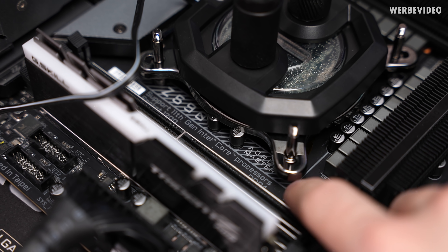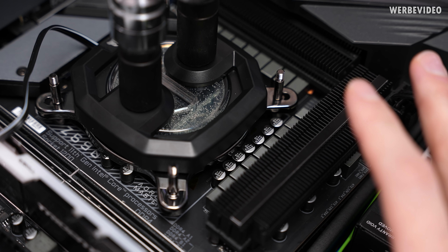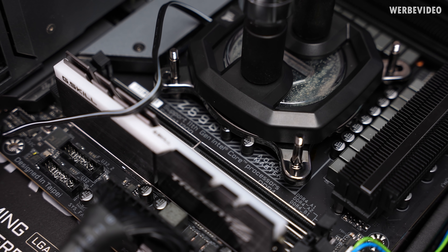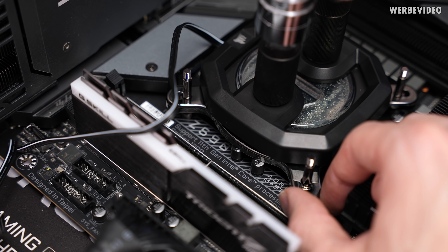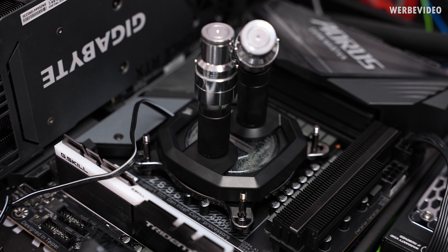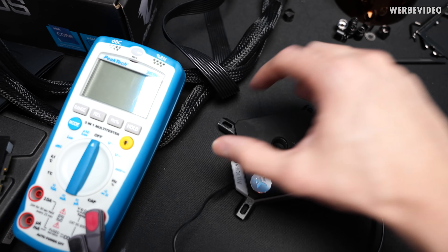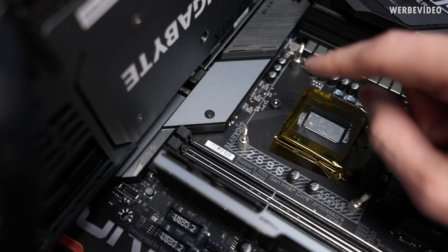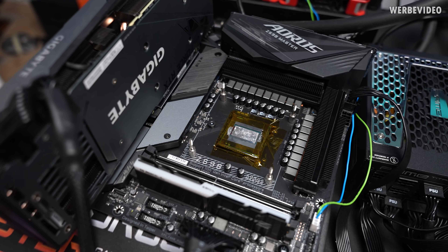You can directly see that the mounting is touching the caps on this side, and also the caps on the back — which isn't directly causing shorts, but it is probably limiting our mounting pressure. That means we'll either have to modify the mounting plate or go for a different cooling block, which would mean repeating previous testing since we'd have different temperature results. New day — let's see if the EK block can manage to do the direct die. The mounting mechanism looks more promising and I've already changed the backplate and standoffs.